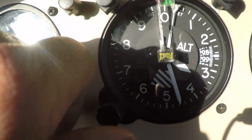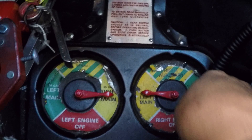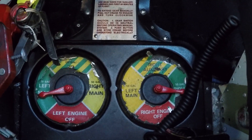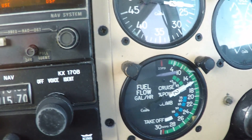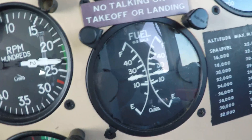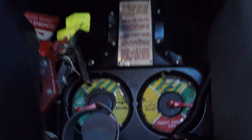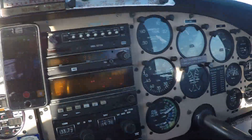All right, so there you go. Now turning everything back to normal configuration — left engine left main, right engine right main. Everything's fine, no fluctuations on the fuel flow gauges. My tanks have half a tank in the mains and half a tank in the auxiliaries. We just confirmed that the cross-feed works as it's supposed to.